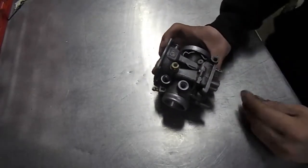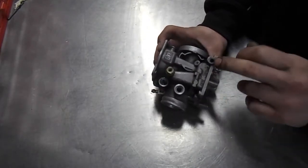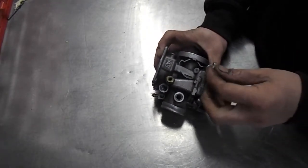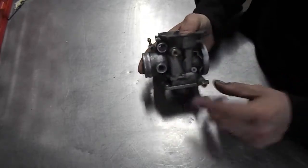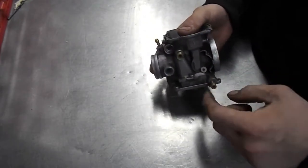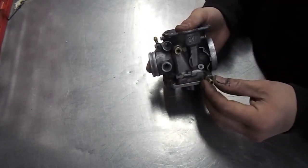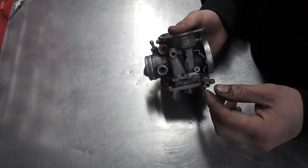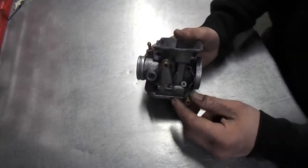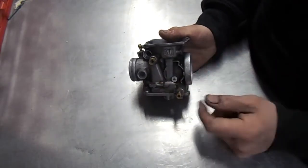This is the carb for my friend's KLR 250 and this is the intake for the fuel. What it's normally meant to be is this brass piece that's pressed in, there's a plastic overmoulded part with a barb coming off for the fuel line. They're quite a bad design and they seem to break quite often. As you can see here where the breather is, it also had the same thing and it's also broken.